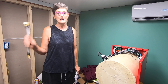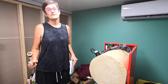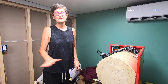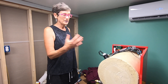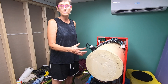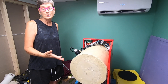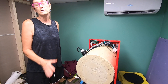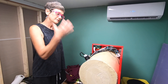Hi guys, it's July 9th and I just wanted to do a really quick update — we finally fixed our freeze dryer! I'm super excited about it and we learned a lot of lessons, so this is a video documenting those lessons. What we had was we couldn't get a deep vacuum — we could only get down to 950 millitorr and couldn't get below that. It's supposed to get to like 300 or 200, and because we couldn't get down, the pump would turn off and we couldn't get through a whole freeze-dry process.